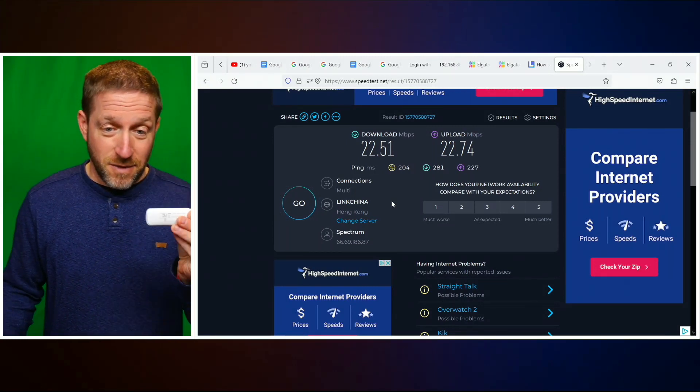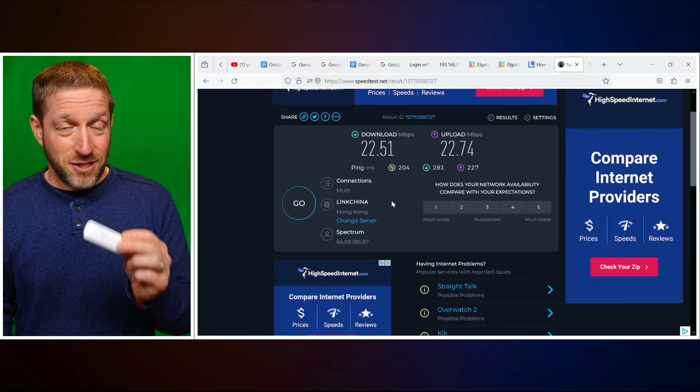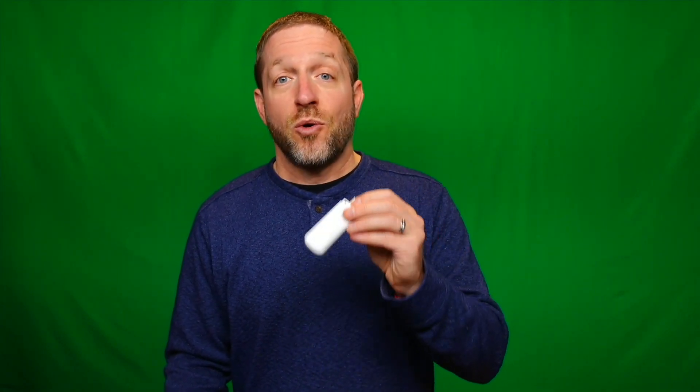The SIM that's in the ZTE stick is a third-party SIM that's roaming — clearly not getting the best speeds available. This is how you go through the process of setting up your ZTE so that you can use it with any SIM on any carrier. You have to go through and configure it first using a computer. I recommend doing a test to make sure it is actually delivering what you need. In this case, this carrier is not providing enough upload speed to make it worth my while — make sure that you have that confirmed before you put it into your streaming device and find out it's not working. My name is Anthony Varoukas for StreamTech.